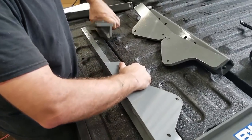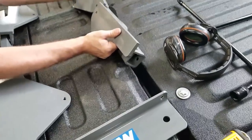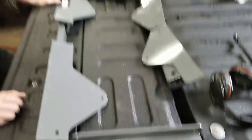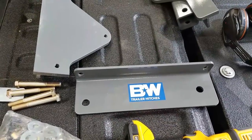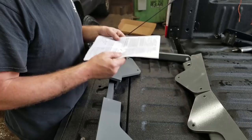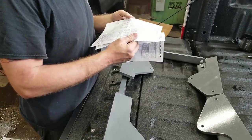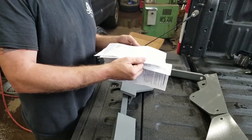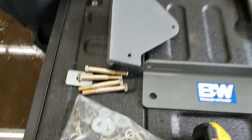All right, so they go on the inside — which even makes more sense. This is amazing! All right, check it out. It's gone — beautiful! It all goes together, hopefully. Does it give torque specs for anything? 5/8-inch hardware to 150 and all 1/2-inch hardware to 100 foot-pounds. Which is just your standard bolt torque. This is good stuff — somebody done went to tractor supply.